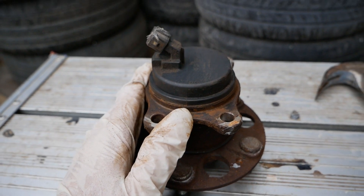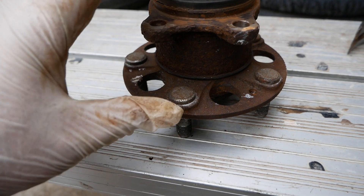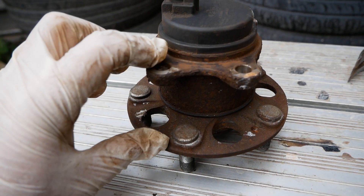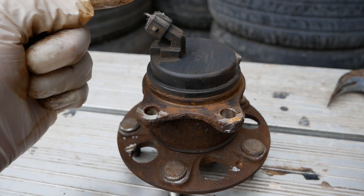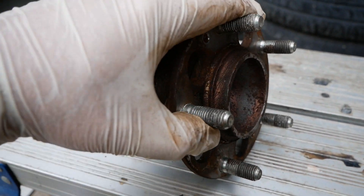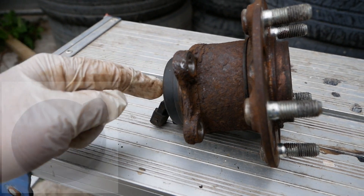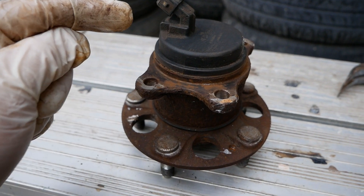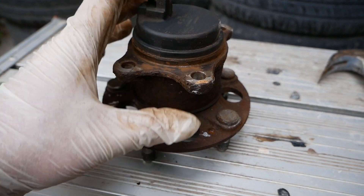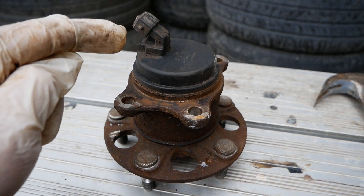If you want to watch my original video, the link is at the top and in the description. To recap, that whole hub cost me £171 with a trade discount — the retail price from Hyundai is £190. Generally a sensor would cost £30 or £40, so it's quite expensive when you just want to replace that sensor. However, this part that Richard spotted on eBay is £36 — a much cheaper fix. But you've still got to take the rear wheel off, the caliper, and disc, then unbolt the hub assembly anyway.